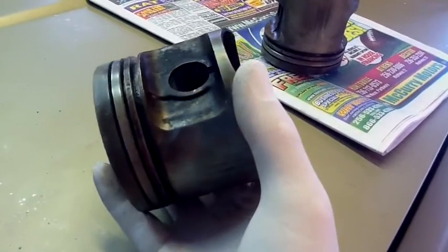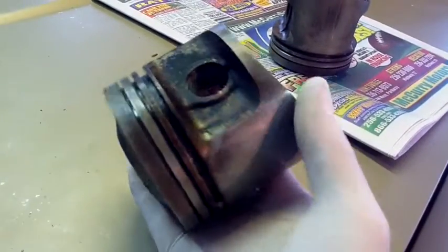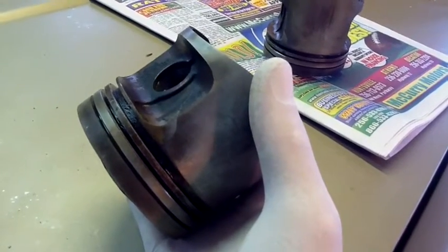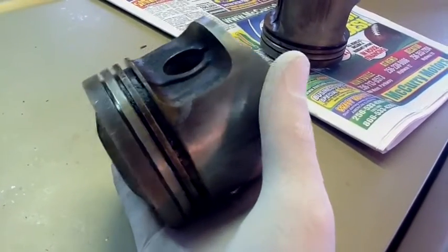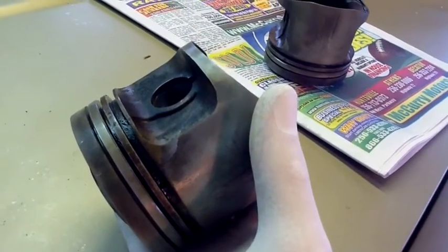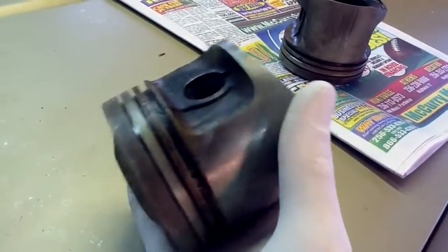I haven't done a YouTube video for quite a while, and I had this strange knock in my car, in my E30 M10 turbocharged engine. I decided to replace the rods and main bearings — everything looked fine there, but I still had the knock.